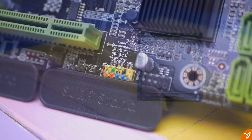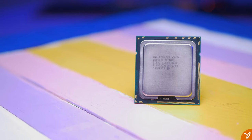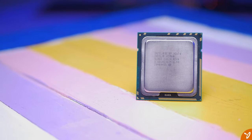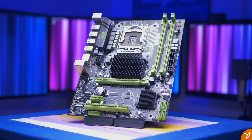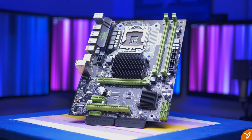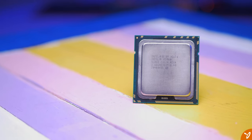This overclock isn't much, but it does squeeze a few more FPS in some games. Running the processor at a constant overclock speed provides a slight advantage compared to auto-boosting from stock. Keep in mind your mileage may vary — I'm unsure if all these boards support this slight overclock. CPU temperatures were surprisingly decent: high 60s on average in Prime95 and lower during gaming.